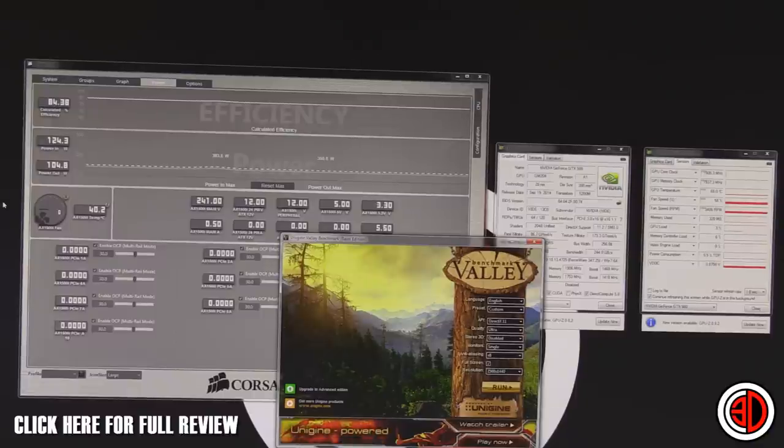You've got two options for the overclock - you've got balls to the wall, but with all those extra volts for just 30 extra megahertz I don't think it's really worth it. Don't forget what I said about the silicon lottery - each card can be drastically different. If you don't get 1,500 MHz the card's not at fault, you've just not won the silicon lottery. You may actually be able to get more of an overclock with less fuss. Please just use this as a guide on how I've managed to get the best from mine.